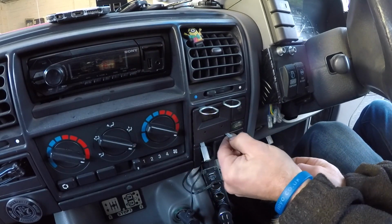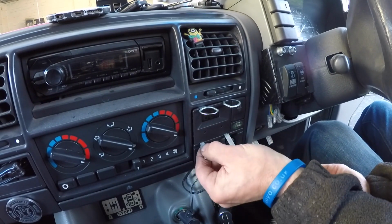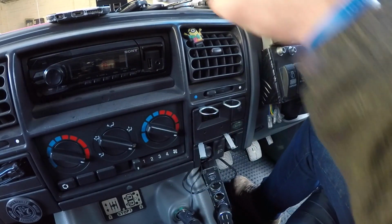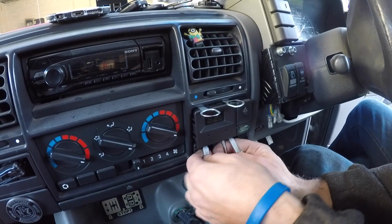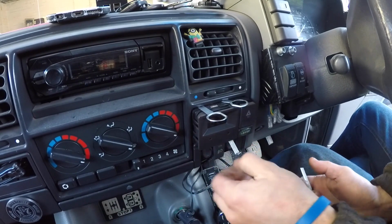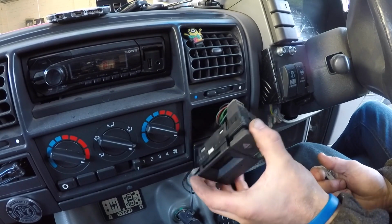that's tight. So the whole clock assembly is going to come out with the hazard light switch, and then we're going to take the hazard light switch out and put that into the new custom casing that Fourby have actually made to go with this kit. Yeah, we'll get that in. I'm just going to use a screwdriver to lever it with. There we go. Yeah. All I need to do is a little bit of leverage, and there you go. That is out.